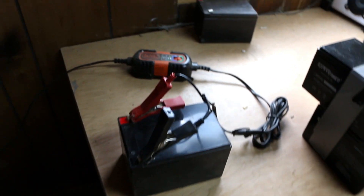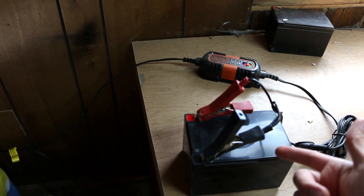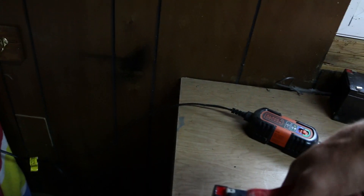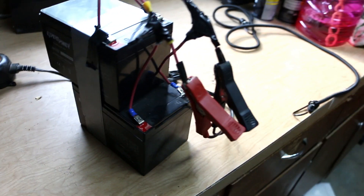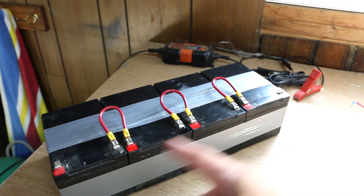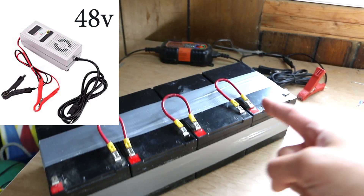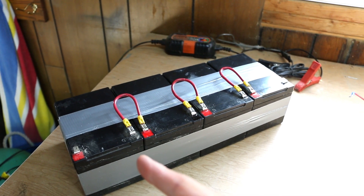The question I get is how do I charge it? When I first set it up, I just had a simple 12 volt charger hooked up to one battery — that was the easiest way. If you want to charge multiple batteries with this charger, like I do with my kids' Power Wheels, you just connect negative to negative and positive to positive, and now you're charging in parallel. I can charge two batteries at once, but it does take a long time because it's still only 12 volts. Ideally, what you would do is have all the batteries hooked up in series like we did for the bike, and then just charge it with a 48 volt charger. This is the fastest way — just leave it the way it is but make sure you have a 48 volt charger. A 12 volt charger will not work; you'll burn up the charger or worse. Just buy the 48 volt charger — it's in the description.